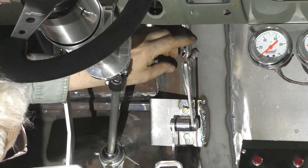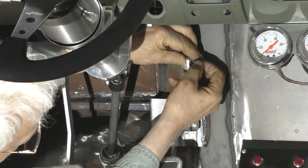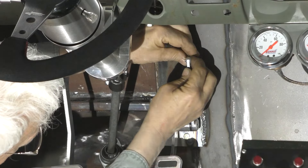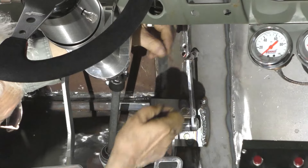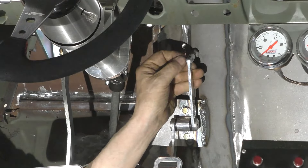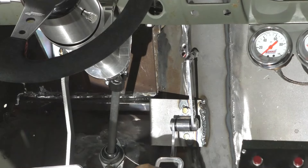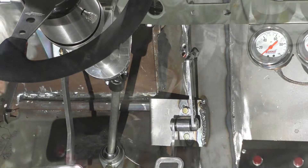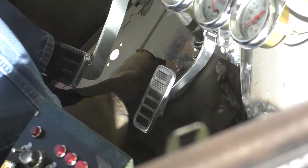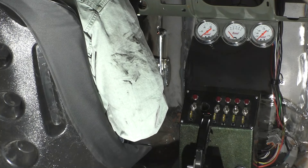Our lever lines up beautifully with the clevis, and now we've got to put the pin and the clip in. Here comes the pin, and now we get this little clip on. That seems good. With the carburetor empty of gas we can pump this all we want — it has a real nice feel through the whole travel, returns real nice, it doesn't bind. We have full travel on the carburetor, and the loud pedal works as it should when everything is turned on.